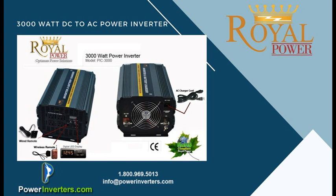With 3000 watts of power you're able to use up to 24.25 amps, which gives you a nice range. If you have a sump pump rated at about half a horsepower or a third of a horsepower, it should be fine with this 3000 watt unit. If you're using it with AC or heating devices, you can always contact us and we'll walk you through the calculations to make sure it'll work for you.